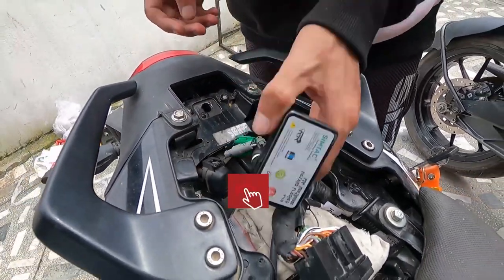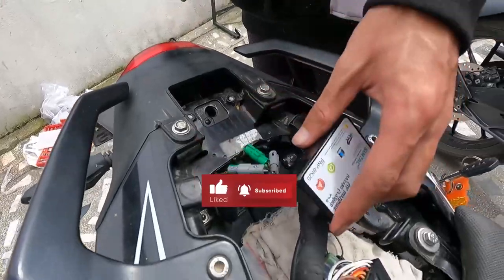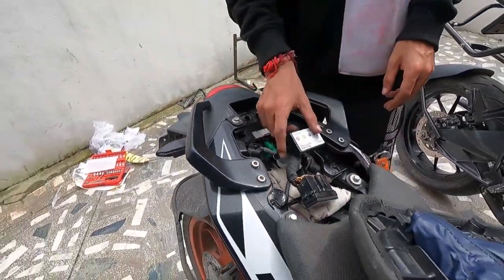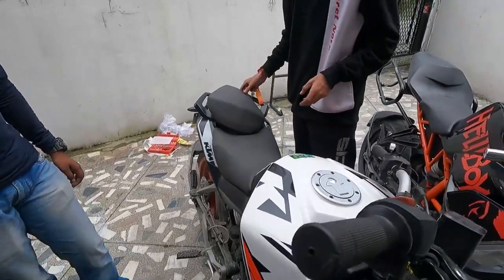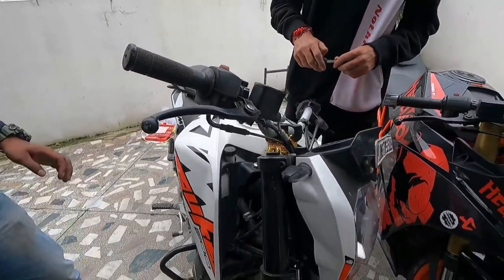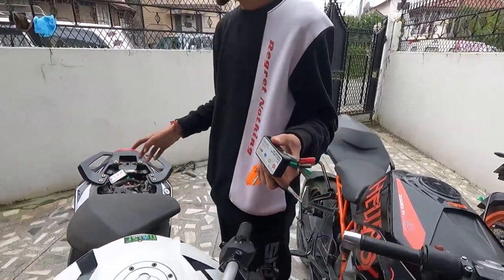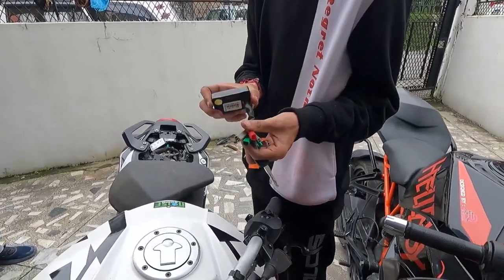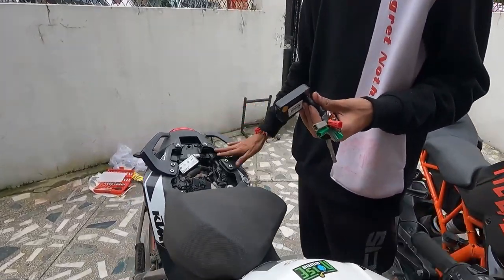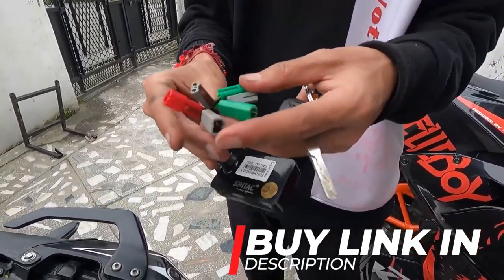It is very easy to place here. This is version 4, so we will install it and then check it before putting it back in the rear seat. This flasher is version 2 — no problem. Version 2 and 3 are easy. All the new modules will use a 6-pin connector.